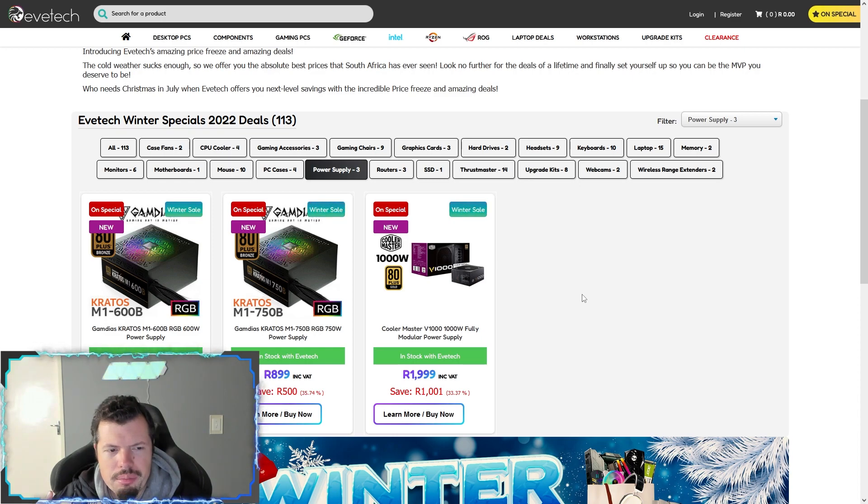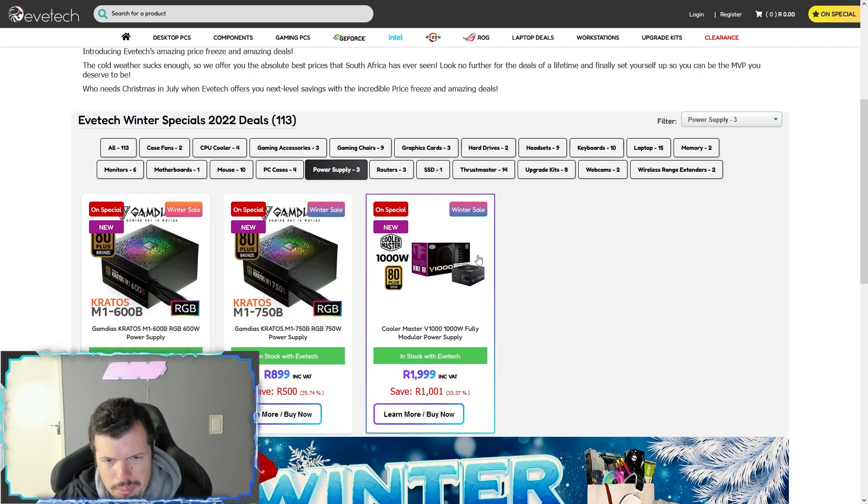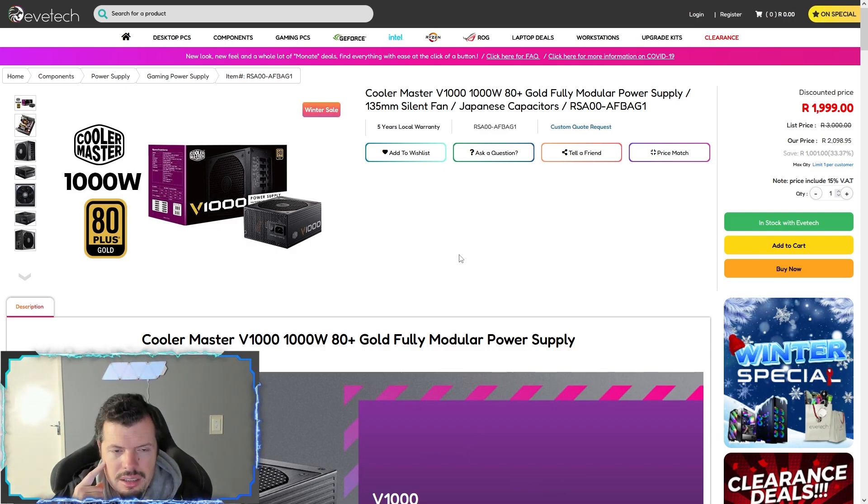As far as power supplies go, there are two really solid ones. The 750W 80 Plus Bronze at R899 is a really solid price right now. But this one over here is exactly what I run in my PC and it is a monster — an absolute savage. This thing has run 3090s, 3080s, 6900XTs — all manner of high-end GPUs — and I never hear it. No coil whine, no fuss, no fan curve noise, absolutely silent. It's full modular, proper genuine full modular, so I only have the cables I need in my system. If you just want to buy a power supply and not have to buy one again feasibly for ten years, just get a thousand watt.